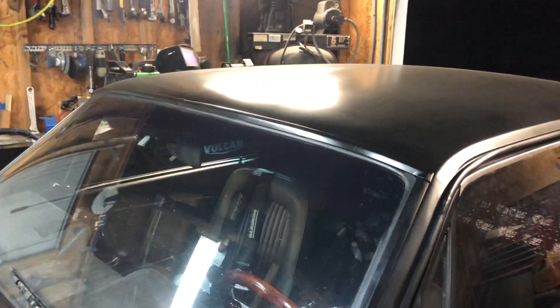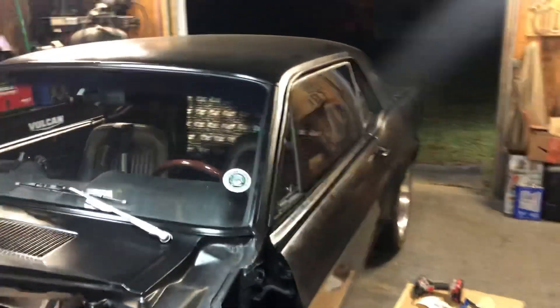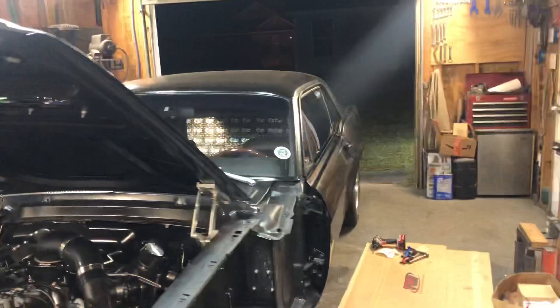The center console work is on hold in case I have to raise the tunnel. I can't do the cage until I have the seats so I can position them properly. I also need the roof liner installed before the cage, since I don't think you can install it after. It probably wouldn't be a full cage — no halo — more like a six-point with the main hoop, rear supports, and door bars. I still need to decide whether to include the door bars or add them on later. I definitely want a harness bar.